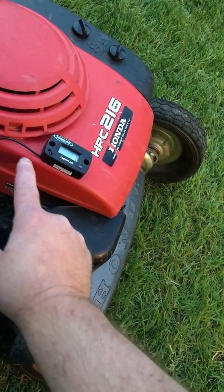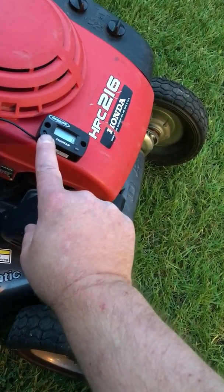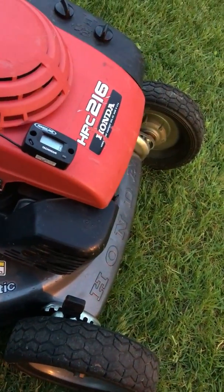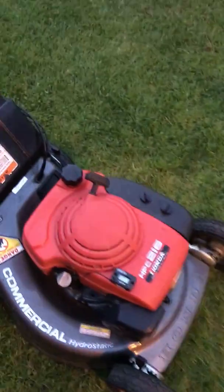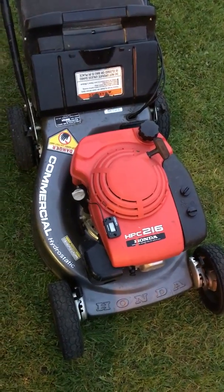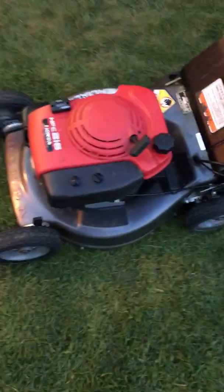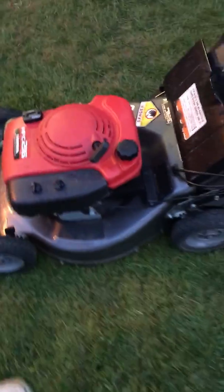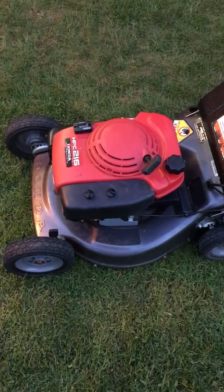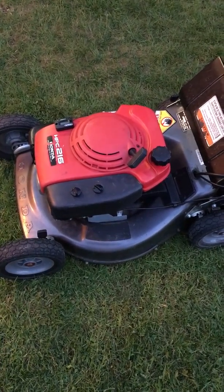This lead is about four feet long — I just cut it down to size. It loops up in here, it's inductive on this end, you push it in and loop it into the top, so you can adjust the length of the wire on either end. If you want to see my method for setting the RPMs, because it's not just a matter of turning a screw — you've got to go in and adjust back here on the governor — I've got another video under the same name that talks all about adjusting the RPM on these.